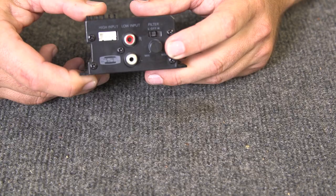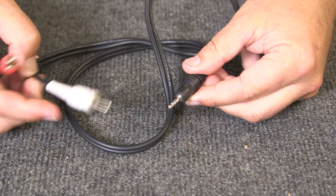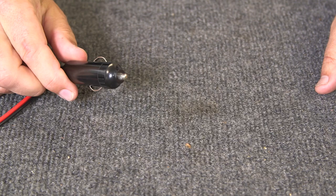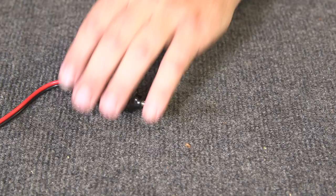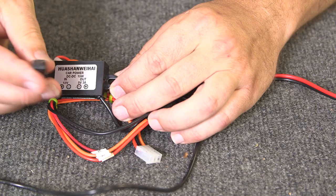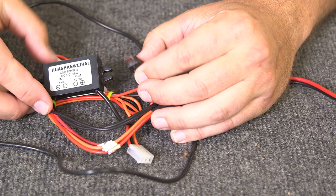To get our audio in we need a cable — a stereo mini pin on one end and line-level RCA audio out on the other. We're going to need a cigarette lighter plug to power everything, and I wanted this to be removable; otherwise I could hard-wire straight to a dedicated circuit in the car. We're also going to use a little dedicated power supply — essentially a DC-to-DC converter that takes 12 volts in and outputs 5 volts with a micro USB output.